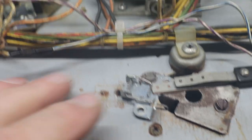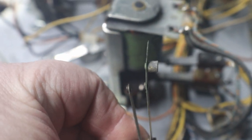This was back here. What this is for is when the ball drains, this is the end of the ball switch. Racks up your points and then turns your solenoid on to kick it out to the next ball or game over. And what was supposed to be here is a leaf switch with a knob on it, kind of like our hole relay, our holes. So when the ball drops down in, it hits that, connects it, and then tells the game that the ball is in the hole. Ooh, in the hole again.